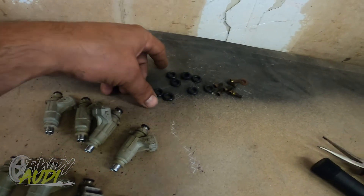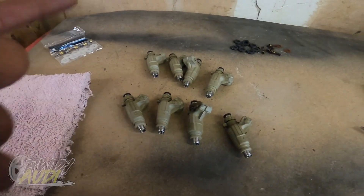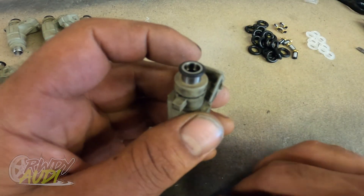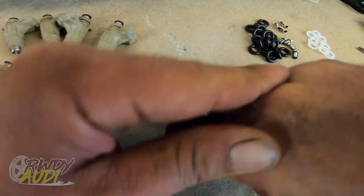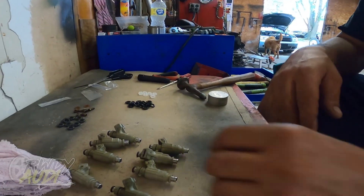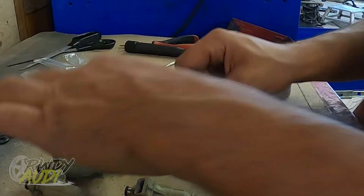So there's all of our screens and all of our injector O-rings. Now that we've got them all disassembled and all our O-rings out, it's time to open up the kit. You've got to get these filter guys back in — they're pretty easy to do though. Just slide that sucker down in there, find a flat surface, and push. Now that you've got all your filters back in, go ahead and start putting the O-rings on. The bottom ones might not stay all that well, but that's no big deal.